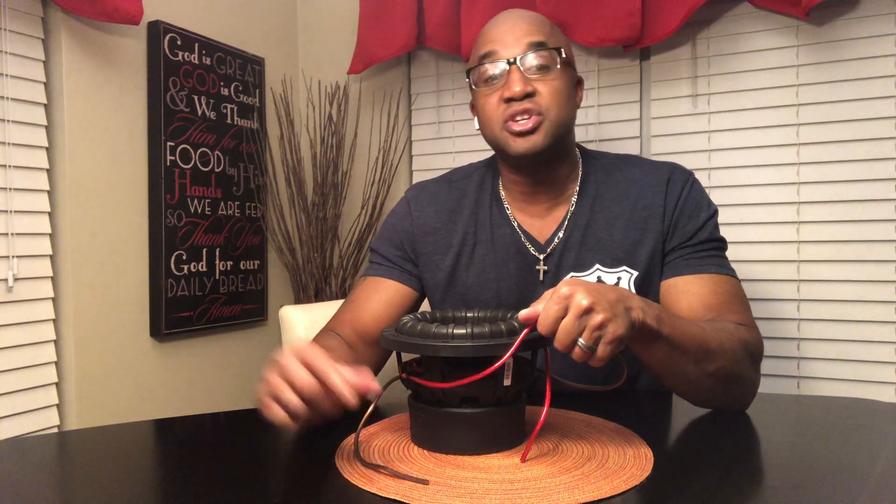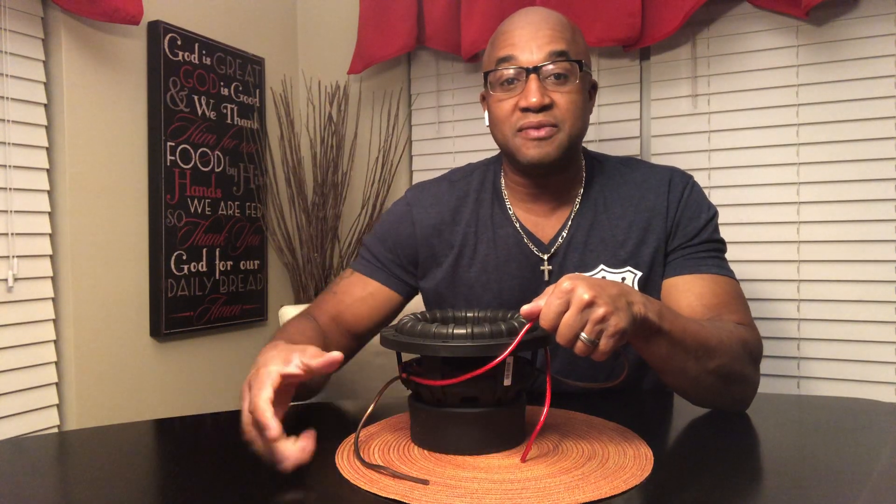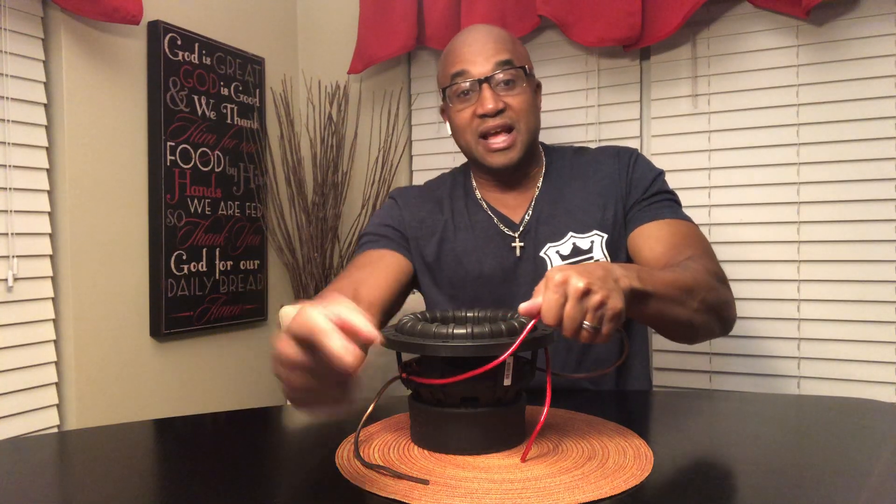D2, D4, D1 are all wiring options. They give you various wiring options to present a certain load to where your amplifier puts out the most power, or the ohm load that you want. Some people don't want the most power — they're also trying to get sound quality. Some might want to wire down to a two ohm load. If you want to wire to a two ohm load, get your dual two ohm subs, wire in series: positive to negative on the sub itself, connect these two, send them to the amp, and connect to the other D2 sub's positive and negative.